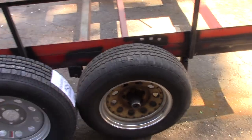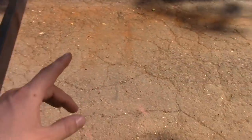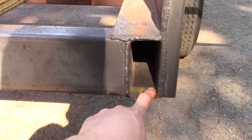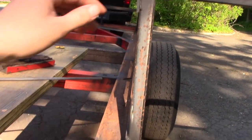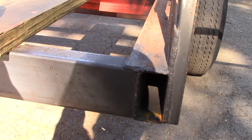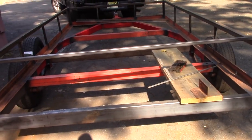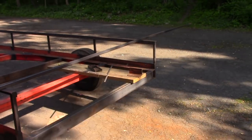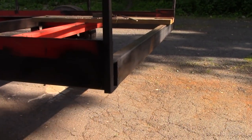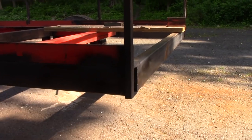What I want to work on now: I got some more work to do on the suspension and I've got to mount the fenders. I was waiting to put the fenders on to make sure they would match the height of the new tire. Today I think I'm going to work on doing this gate, which shouldn't be too bad. I had to close up these holes in the frame channel anyway, so I'm planning to do a simple drop-down gate that matches this height, hinged off these angle brackets which I'll weld in. It's just going to be a simple gate to prevent anything from coming off the back.